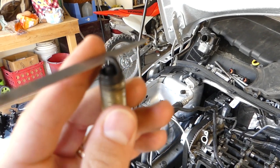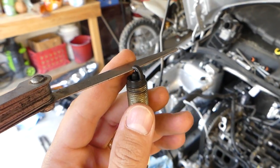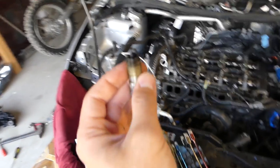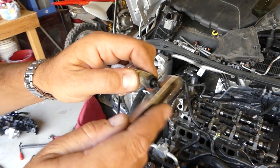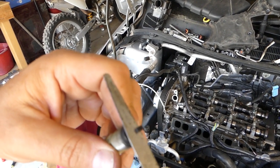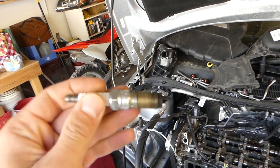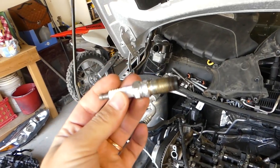Place the shim here in the spark plug. You can see we have a little bit of play, which means we'll have to gently tap it on top and measure again until it fits really, really close. Right now there is absolutely no play — you can see it's correct. So that's what the gap should be: 0.7 to 0.8 millimeters for the 1.6 engine.